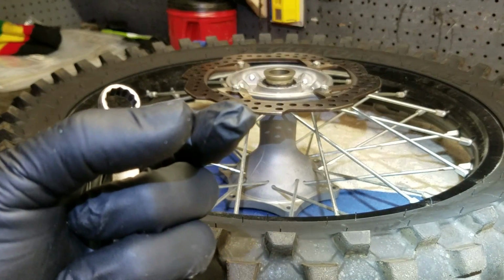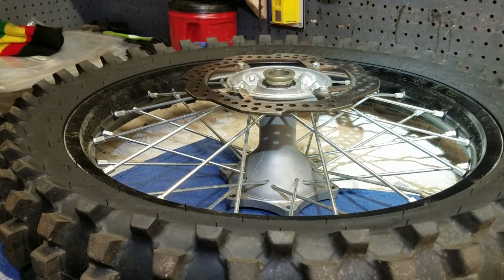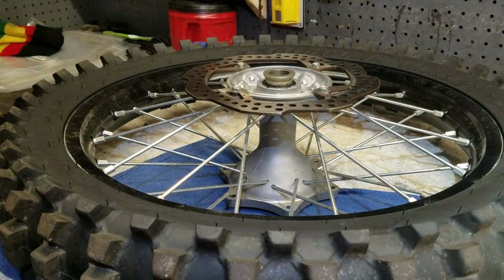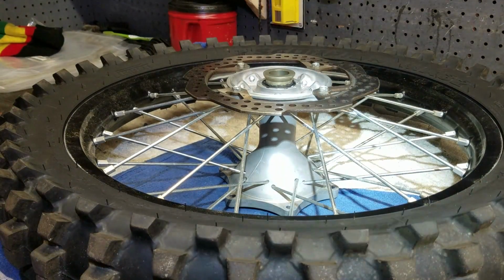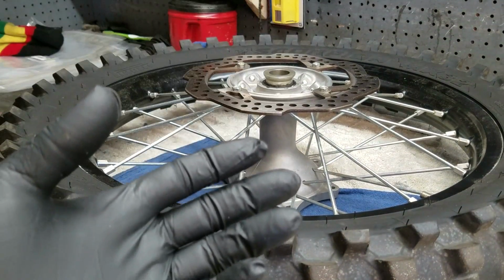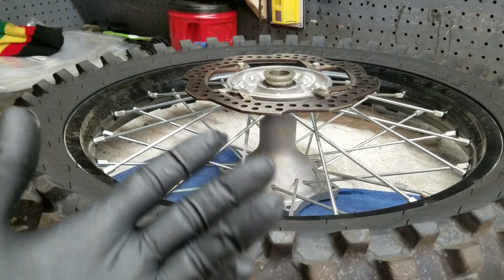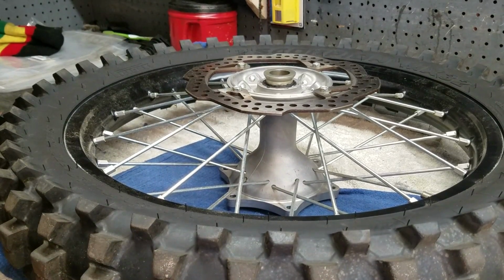The shafts might be sitting still, or they might be moving a different direction or different speed than the gear that it's on. You're breaking in a lot of stuff. That's the point. So on your first 3 rides, I say make them shorter rides, 8 to 10 minutes long, and try to avoid high speeds, cruising at the same speed, and try to avoid full throttle. After that, I believe you're good to go.